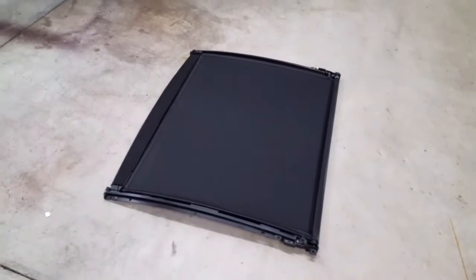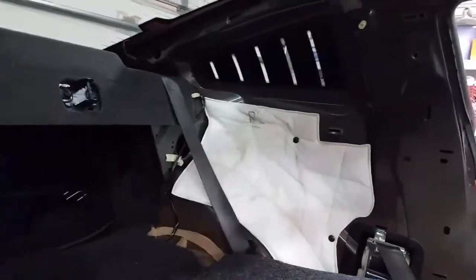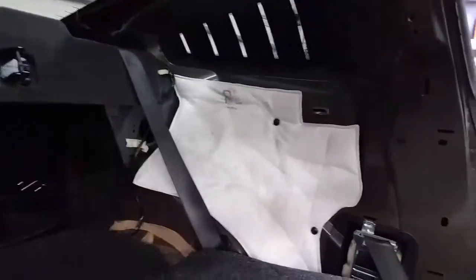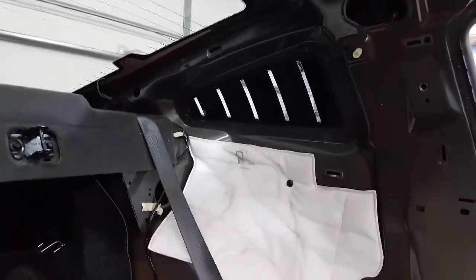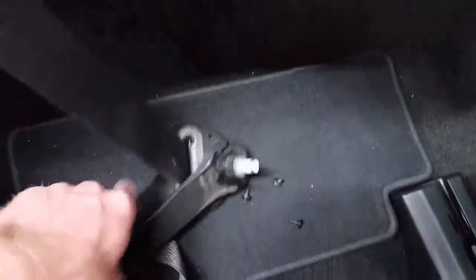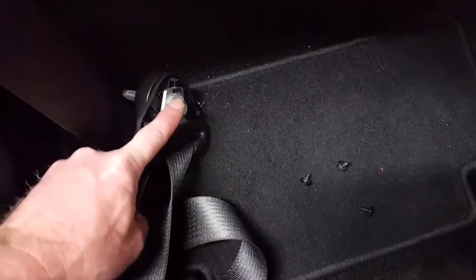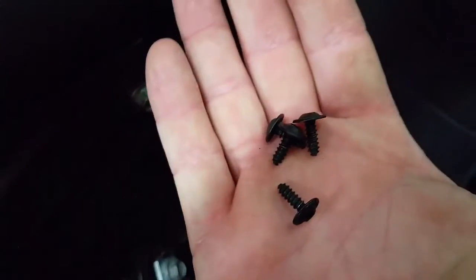We're also going to take a look at the inside and how to get this out. Here is the interior with most of the trim removed — the C pillar and then the A pillar cover, also the visors and the courtesy light has been dropped down and unplugged, and then the A pillar. We can see these are the seatbelt mechanisms. The seatbelts themselves come unscrewed — you simply use your screwdriver to pry off the little plastic cap and then use a 14mm to take that out. These are the four tiny little screws that hold in each side of the sunshade.